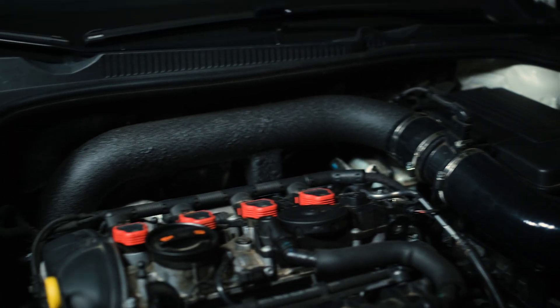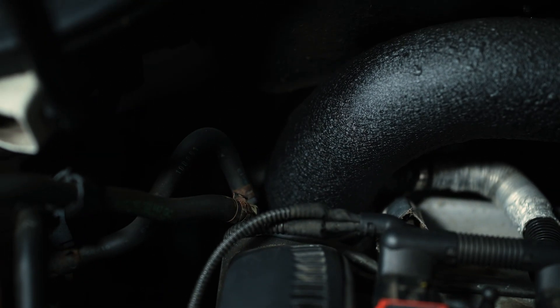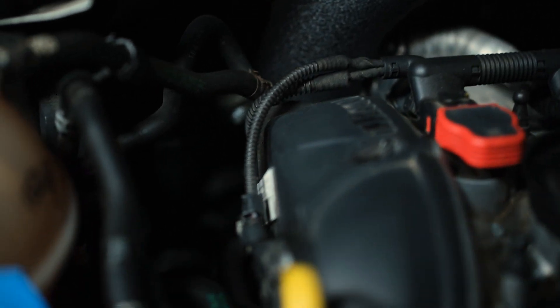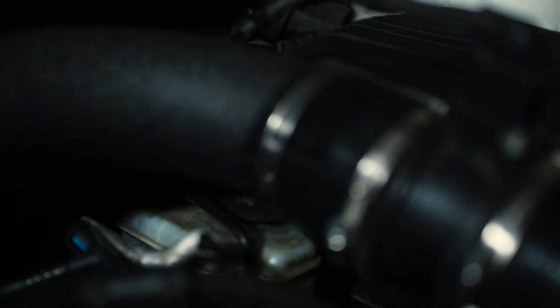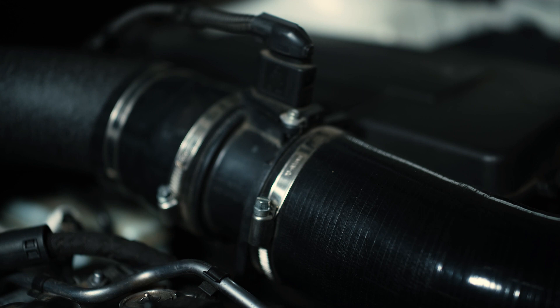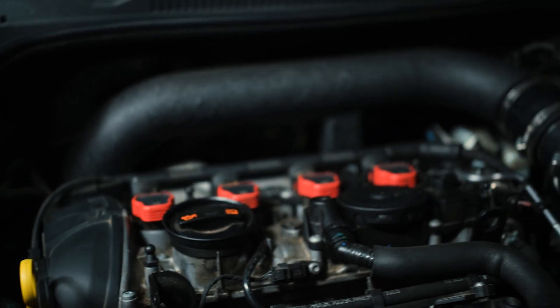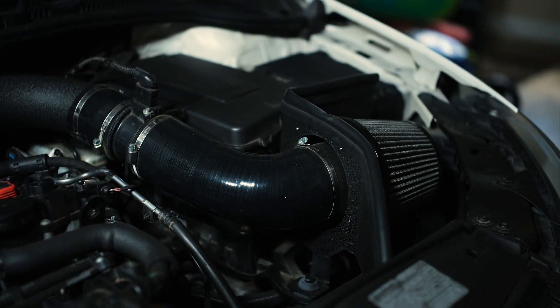Here is the engine bay in all its beauty. I think the culprits are right down there where the turbo goes in - it's a reducer and since I can't even get a good view on it you can tell it is very cramped back there. It was very difficult to get all of that to sit properly. One of the other things I want to fix too - that hose clamp you can see is very wonky. We're just gonna go through and get all of these properly situated so that we know the boost leak isn't in the intake.